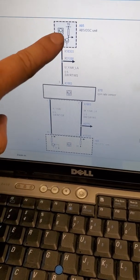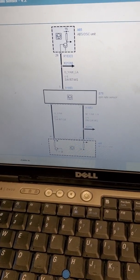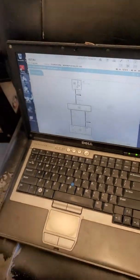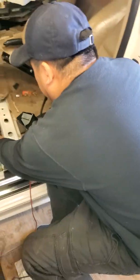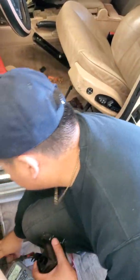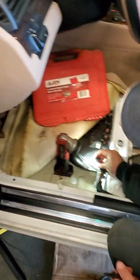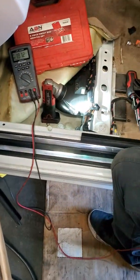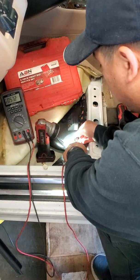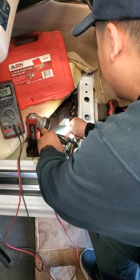We're going to pin the signal wire and check the voltage. According to the FEV spec, at vehicle stationary it should show an offset of 1.8 volts, but I'm seeing 2.5 volts. I'll connect the voltmeter — ground goes right at the door hinge E10 bolt — and here's the connector. Pin one is the black line with red tracing and yellow marking; that's the signal wire.